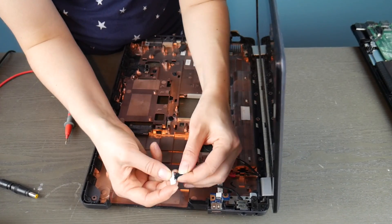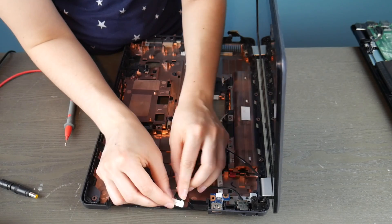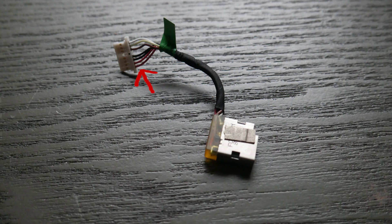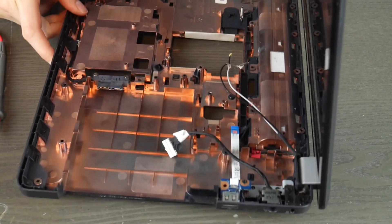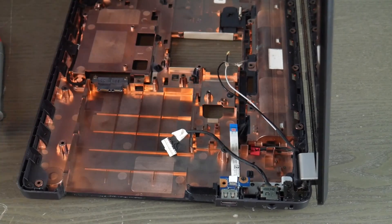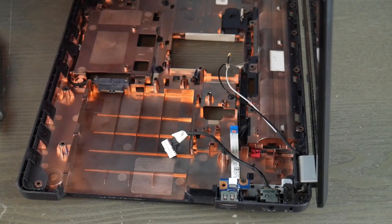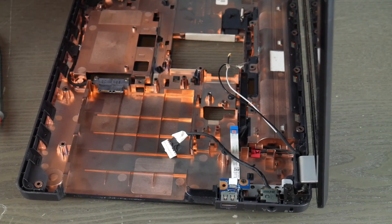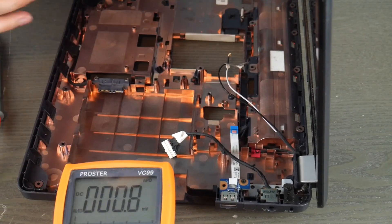So this is a wired kind. Where's your power jack? Well, it's where you plug in your power cord, to put it simply. And I'm going to look at these wires. As you can see when I get up close, you have red wires - that is where you take your multimeter and put the red prong on that. And the black one, you'd be testing these black wires with it. So I'm going to plug it in first, and then I'm going to take my multimeter and test that power jack.